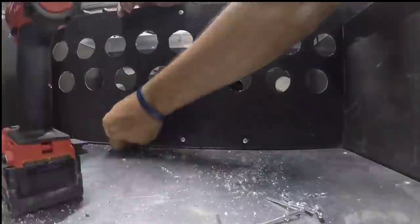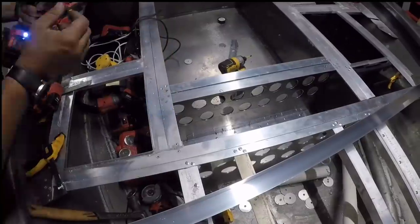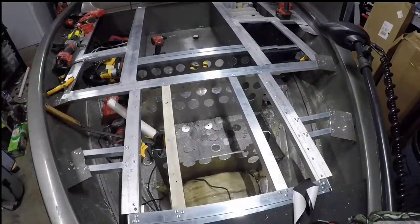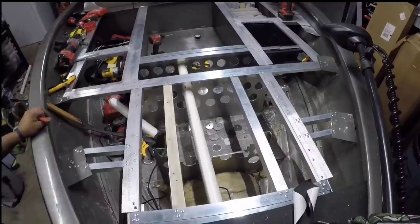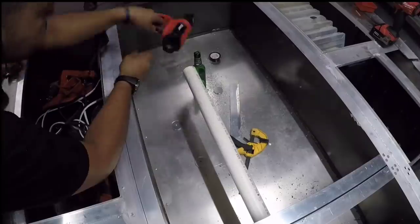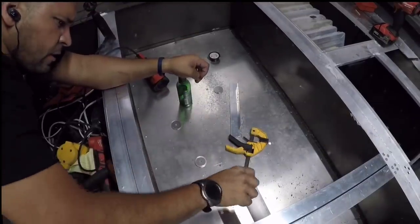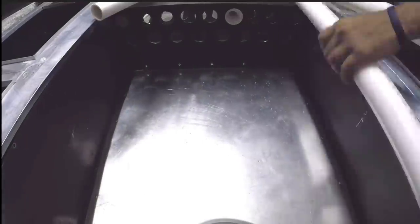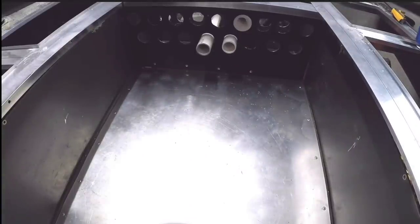Overall we have 17 holes. I really wanted 20, but we'll make do with 17. We are tapering and putting in countersink rivets into the top of the frame because we're going to skin it later, but before we can do that we really have to focus on all these rod tubes. To taper these tubes, you have to put a fair amount of heat evenly around the end, then shove a bottle in there and hold it until it cools and forms. That will help us secure the tubes and prevent breaking off eyes in your rods. You might have to do a little residual sanding if you discolored it, which we had to do for most tubes.